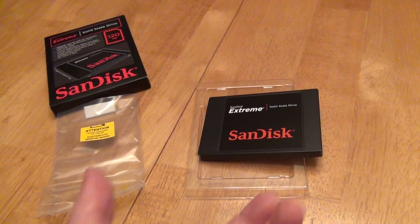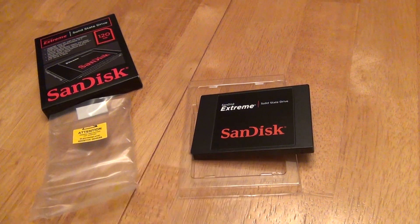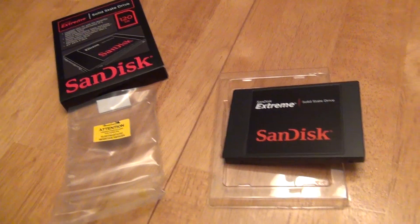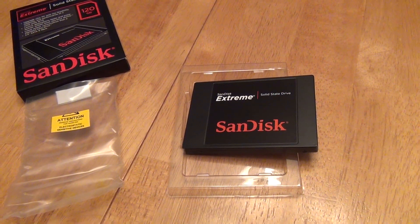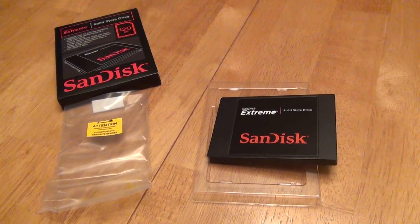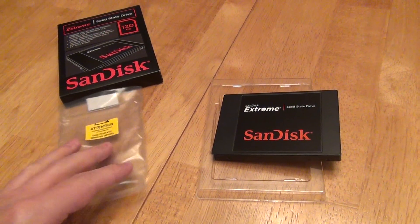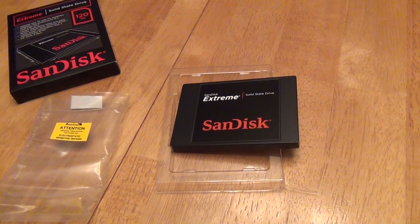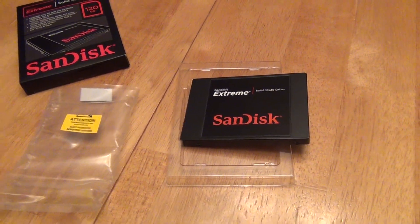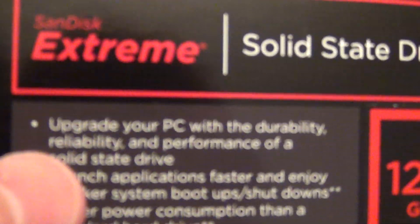Then you want to expand the image so you can use the full size. Hopefully your original disk drive wasn't using more than 120 gigs — and actually you have 111 gigs once this is properly formatted. There's also other cloning software like Clonezilla. I tried some of the freeware stuff to simply clone my existing hard disk drive to this one, and it was a failure. I could not get Windows to work on this. There are other brands out there that actually provide a better upgrade experience if they're going to claim 'upgrade' on the box.